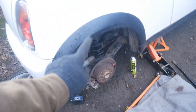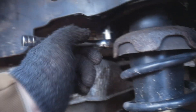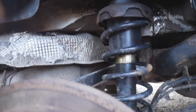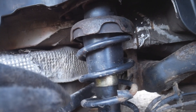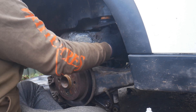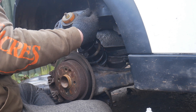Now we're going to take the two top bolts out of the strut and drop the rest of it out. The top mounting bolts are 13mm. Got the right-hand one out, just getting the left-hand one out now — I need a hand ready to catch it because it will drop. There are two cables in the back of the strut which I've just looped up so I can pop them out.